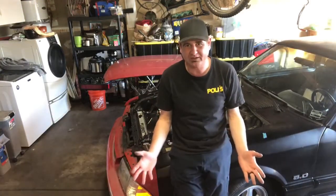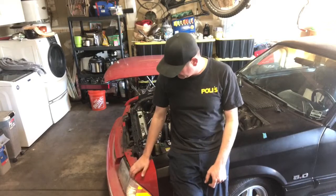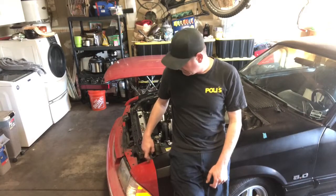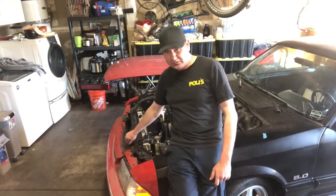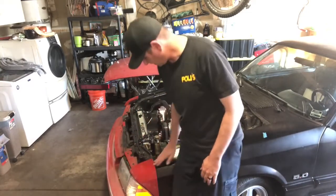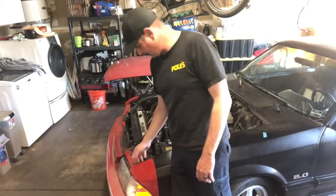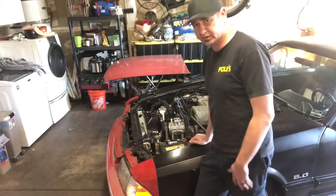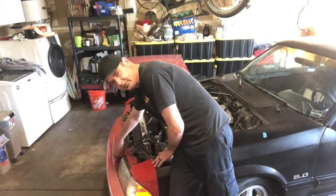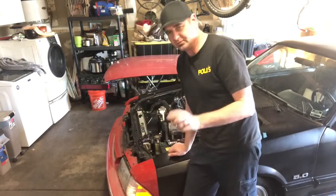Wow, well, that was quick. It's almost like magic. Anyway, all I did here was throw this thing on and stick a nut on the top of each side and then screw these middle things down a little bit. I'm not looking for a perfect fit right now. There's a good step down right here because it's kind of hard for me to get my hand back there and get it nice and tight. So really all I'm looking for is the fit up here where the hood meets the top of the front bumper. That's what I'm looking for.